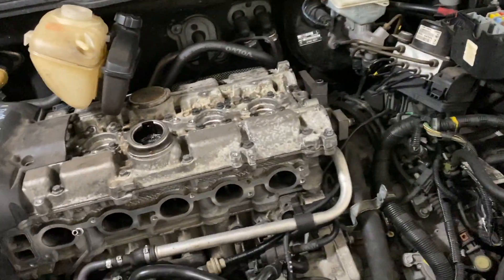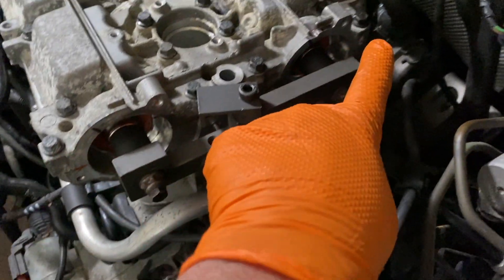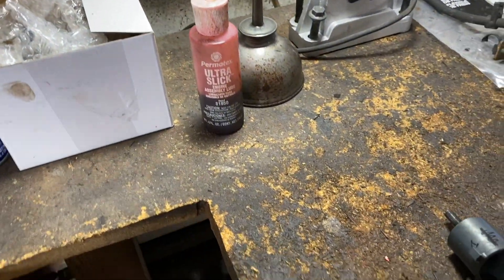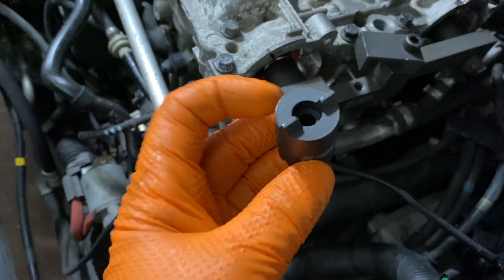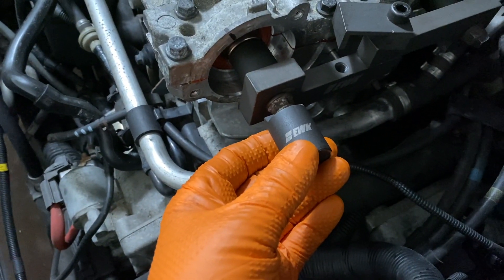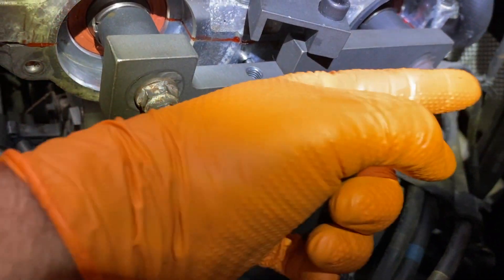You're going to need a tool. I'll put a link in the description. You can get it on Amazon for about 40 bucks. What this tool does is it locks the cams in the proper position so you can adjust the front. Basically it's two bars — and there are extensions for it. Sometimes on some engines you may need an extension to clear something. One is offset higher, one is offset lower. One goes on the intake and one on the exhaust — you can't really mess it up. There's a screw that tightens them both down and keeps them nice and straight.